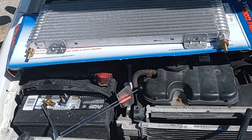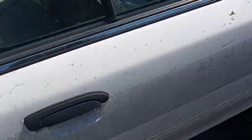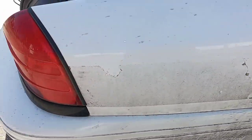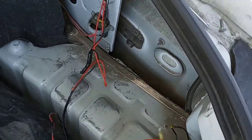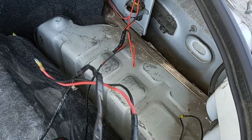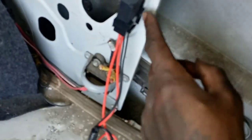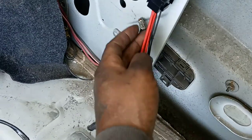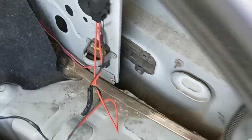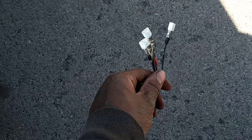I'm also doing the fuel pump. Let me go show you — I did pull it off the white Vic. The white Vic is definitely the other one that's so much cleaner, but it is what it is. So this is what I ended up pulling off: the complete harness off of the Vic, the other 2011 one. Actually it's pretty easy, because these are going to be my power lines going up through the car. You just simply pull the top off and put a screw behind it, pop that on, and then you have your relay triggers to your fuel pump. And since all the little connectors are still on there, it saves me a lot of time and work.